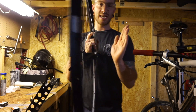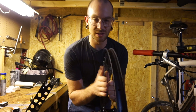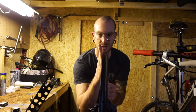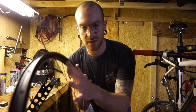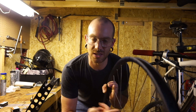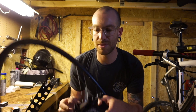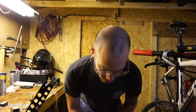As you add more tension to the lower tension, longer spoke side, the higher tension side sort of suffers because those spokes are starting to get a little more straight. The longer spokes want to pull over a little bit more, so a little more tension needs to go on the shorter side — the brake side for the front or the drive side for the rear — and maybe a half turn needs to come off the non-brake or non-drive side of these wheels, and they should hit right in the center, or close enough for where I need them to be for this bike.